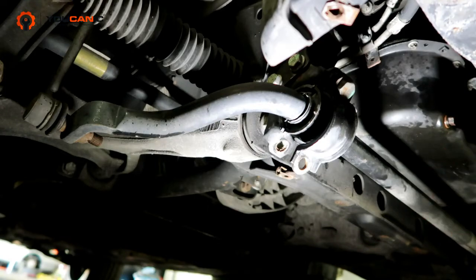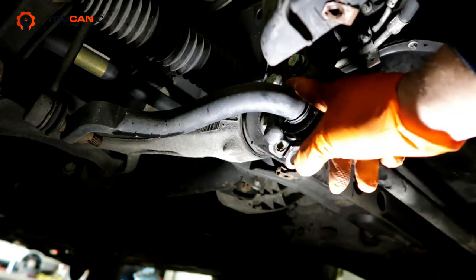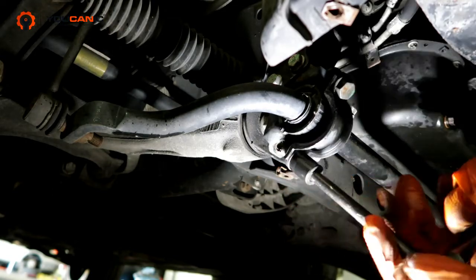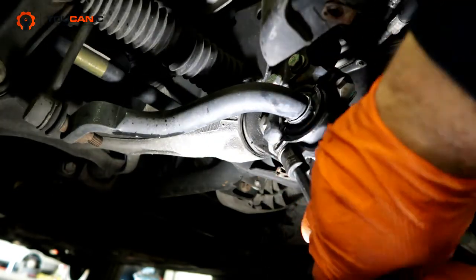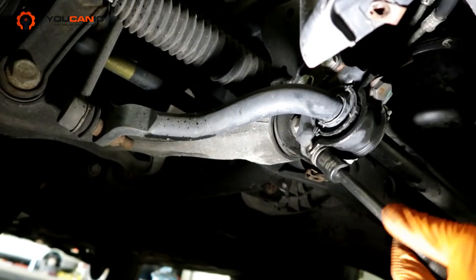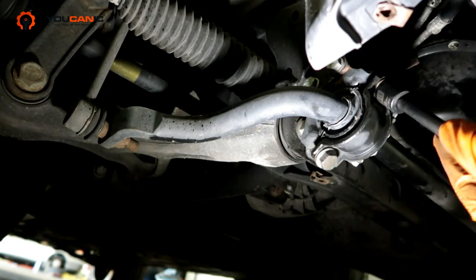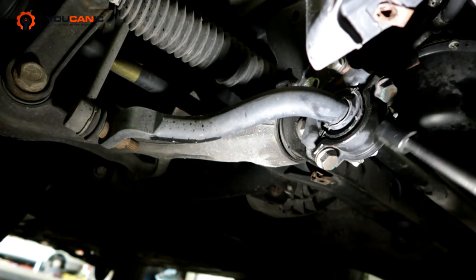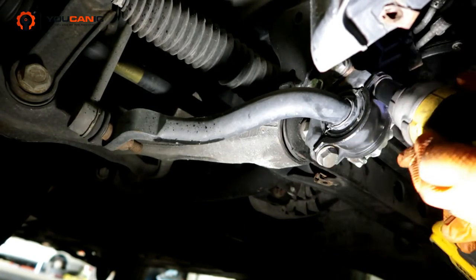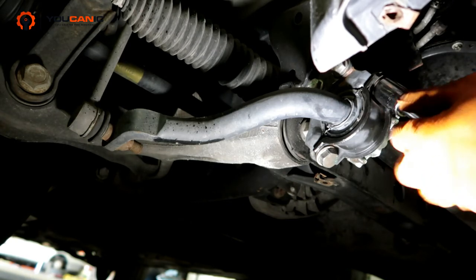This is the challenging part: if the vehicle is raised unevenly, you'll see that this is not pushed all the way up and you'll have problems putting these bolts together. You may have to play with raising or lowering the vehicle a little bit. Make sure that bolt goes in nice and smoothly before you use any air tools or impact gun. You also need to torque this to spec — make sure to look in our step-by-step guide for those torque specs.